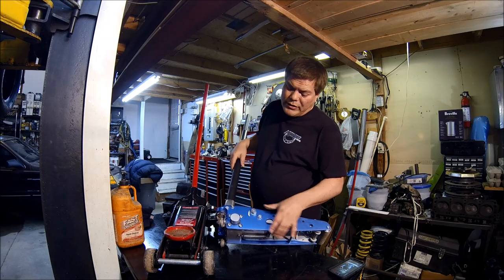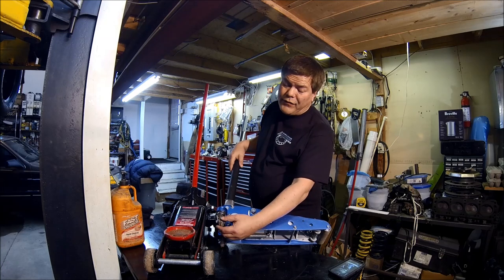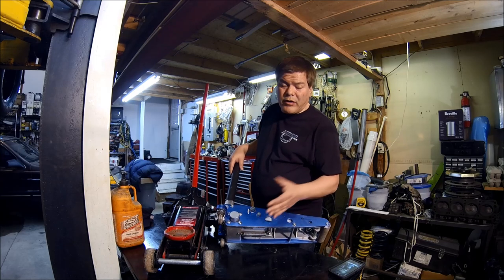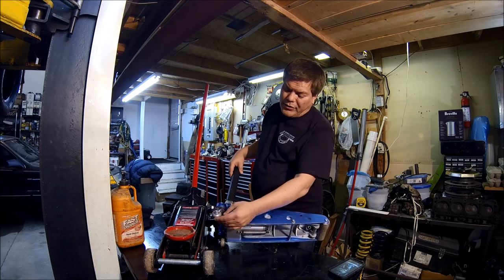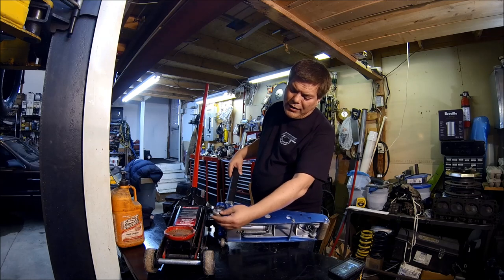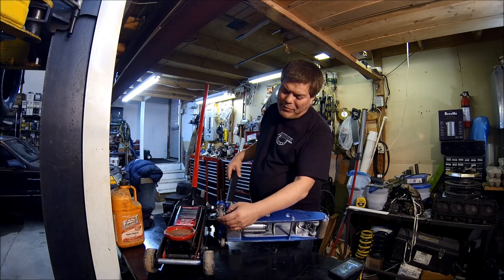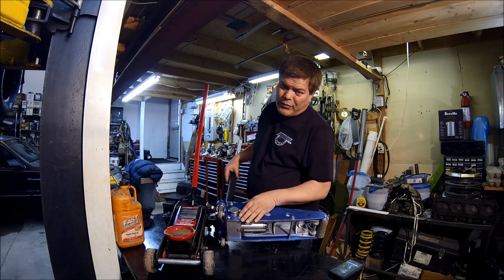The only other thing we want to try to do is, these casters are often a little bit slow or small for the back end. Particularly if you're on the grass, if you didn't get there early enough to get a paddock, a pit stall with concrete. And even then, in some cases, the concrete pads are so narrow that your wheels are still off the edge of the concrete. So what I'd like to see is if we can machine, using the same style bolt but a little wider, get Adam to machine on his Monarch lathe a wider wheel with a bit of a hem, but it should still be aluminum. It doesn't need to be tire, obviously. We want the low clearance. We just want a wider one for a little more stability, and obviously the forks that would go down.